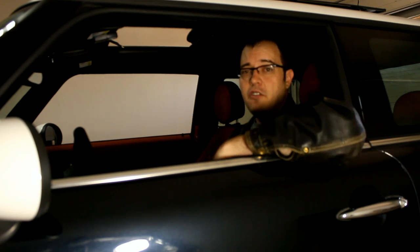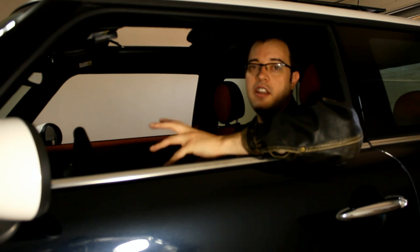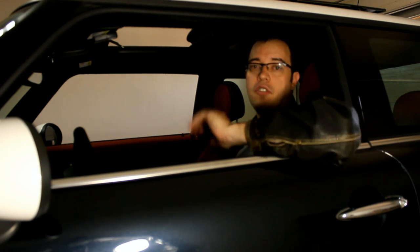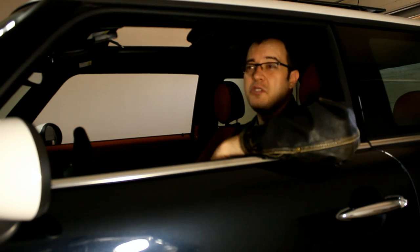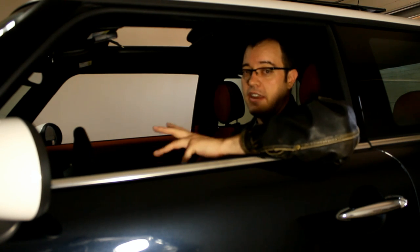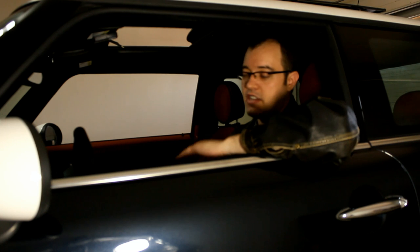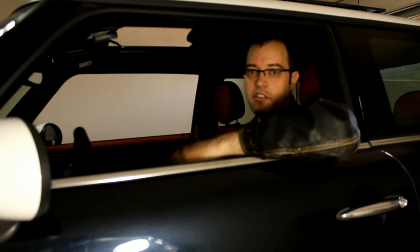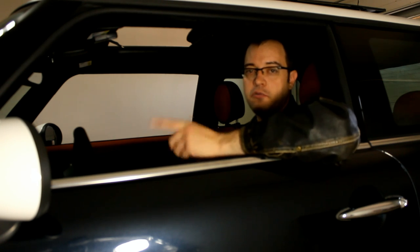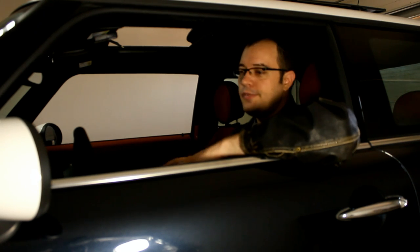Upgrade the stereo — I did a video on that and it was definitely well worth it. And spend the couple of bucks to get the upgraded tensioner for the timing chain, because those things break a lot on the Mini Cooper. I just had to have my timing chain replaced — that was $1,600 — and it hadn't broken yet, but it was making a lot of noise, sounded like a diesel. If you do it early it's $140-ish to have the upgrade done at the dealer, and it will save you that $1,500, which will let you buy $1,500 of parts later when your friend's fixing his timing chain. Upgrading your Mini Cooper on a budget.